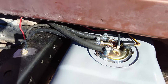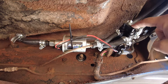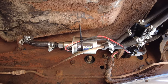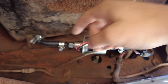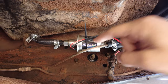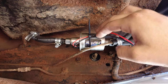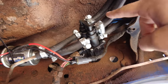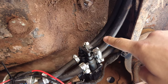Let's get underneath to the tank switcher and I'll show you my setup down there. Here is the setup. I have the electronic fuel pump before the tank switcher, which actually works out — it is just one fuel pump for both tanks, so I had zero issues with this setup. I do have this hard line cut for the backup fuel pump because the backup fuel pump had an inline filter on it, which made it a little bit longer. So I measured and cut it for that. If we ever have an issue on the trail, it'll be extremely easy to switch it out without cutting any hard line. I have everything completely hooked up to the tank switcher — this is the return and this is the feed line from the driver's side tank.